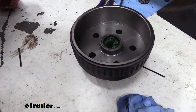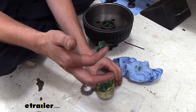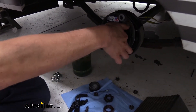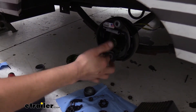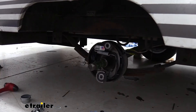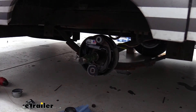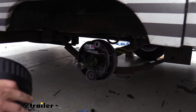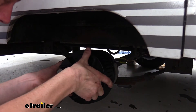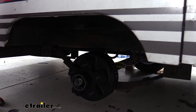Our other bearing will need to be packed, so we're going to go ahead and pack that bearing. I also like to take some of the excess grease and smear it on our axle — it just helps make everything slide together a little bit easier. Just put a little bit around there, but try not to get any on the other side of your grease seal, because we don't want any grease getting into where our brakes are. We'll now take our whole assembly and lift it into position — try to be careful not to nick the seal on your shaft when going on.